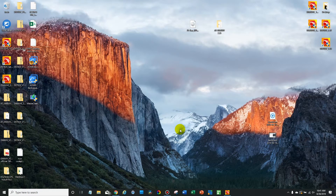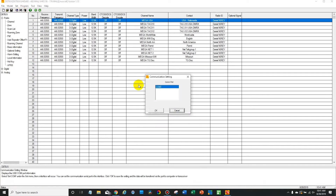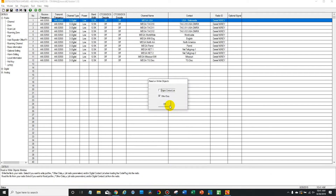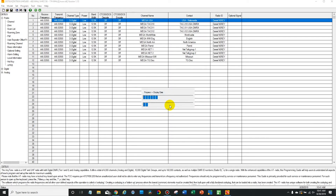In the small chance that this did not work for you — some radios actually come shipped with the option to reinitialize disabled, or maybe you've downloaded a code plug or changed the setting along the way to disable this. Go ahead and open up your Anytone CPS, get your radio connected, plugged in, and turned on. Go to the optional settings, and first you want to read from your radio — just pull in the latest data from it — so you won't overwrite anything when we re-export.